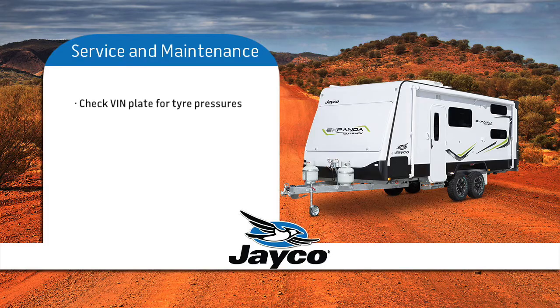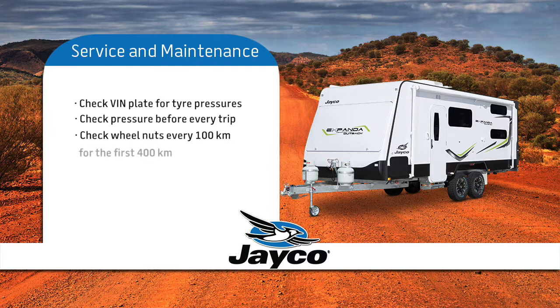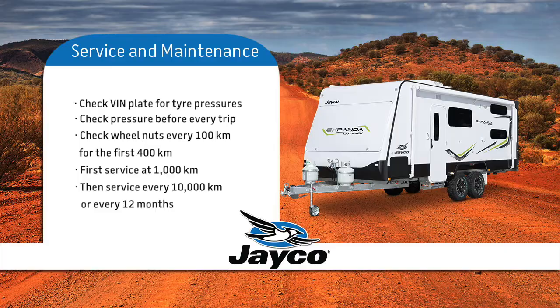Check the VIN plate for correct tyre pressures. Be sure to check before every trip. Remember to check your wheel nuts every 100 kilometres for the first 400 kilometres. Your first service is at 1,000 kilometres and every other service after 10,000 kilometres or every 12 months.